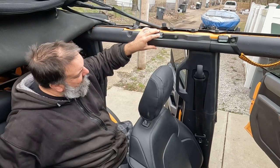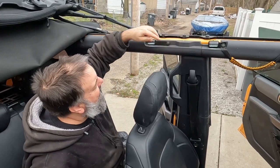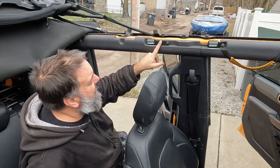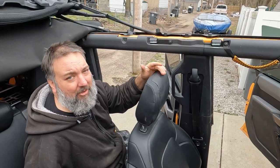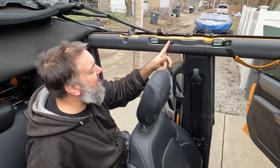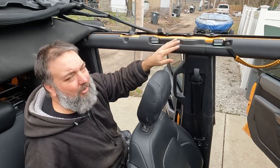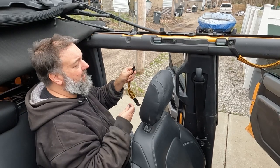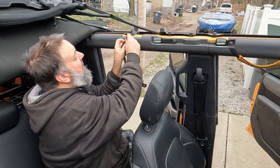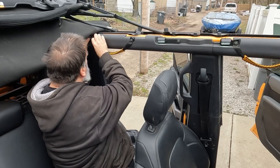And there's your front and rear light on this side. If you have that bracket sticking out, this would hit it. So they have an extension bracket which will move the light back a little bit. If you have the hard top prep kit or a hard top, just be sure to order the extra brackets they have available — it moves this light forward and this light back just so it clears that bracket. But if you have a soft top or don't have that bracket, it fits right in there, then just these couple of screws. And that's it — this side's done. We'll go ahead and do the other side, it's the same exact steps.